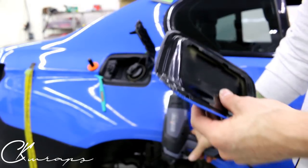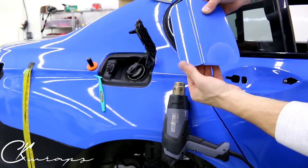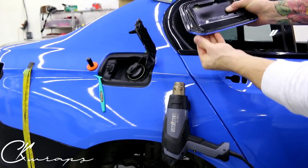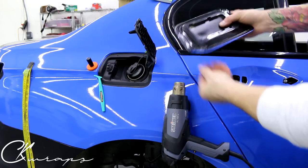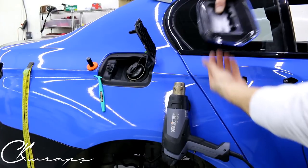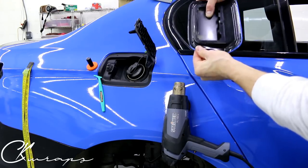Let me mount the heat gun to the car so we can see what's going on. We have tension running around the corner — when we heat it, it shrinks around. It's already shrinking around the corner; I'm just going to help finish it off. Another little trick: the warmer you make it when doing these edges, the easier it is to get the wrinkles out. We start by running it slightly around and then we roll it — push down, add heat, push down, roll it around.